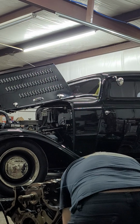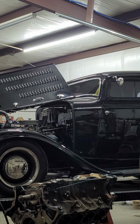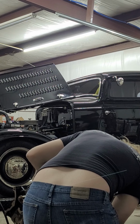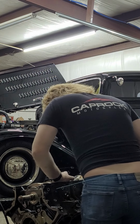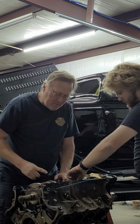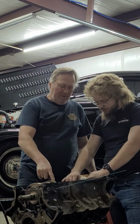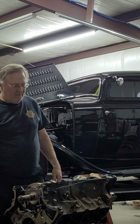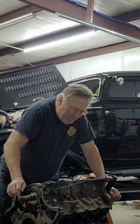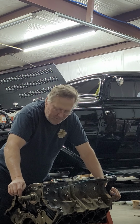We'll get a box later and put all those in. Does this one have an Allen key in there? It comes out front. The keys are inside. So, we saw on the Cobra block, I don't think this one is the same way. But on the Cobra block, there are little, almost dowel pins, Allen keys in the middle of them, that the side bolts go through. The side bolts actually have an Allen that goes in against the side of the main cap, to lock it, to kind of center it. I think that helps these ones do that too. How does it come out? Allen. I didn't see an Allen key in there. Well, it's there. Let's get an Allen set and get those back out. It's basically a little bushing that goes in there that registers on the side of the main cap.